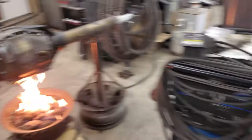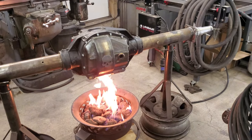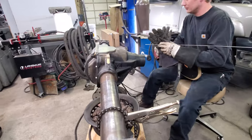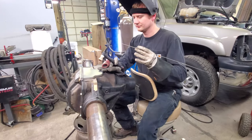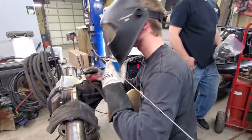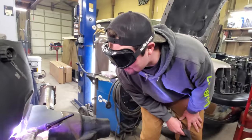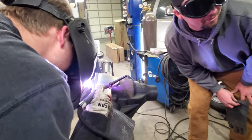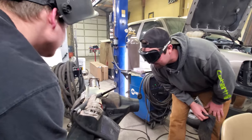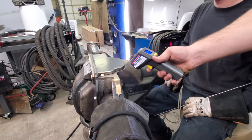The machining's all done, we pressure-washed it, and we're getting it warmed up for some welding — trying to get the whole housing hot and then we can use a torch right around where we're going to weld. We need to be under 400 but over 250 degrees — we're doing pretty good, so at least it's holding heat.